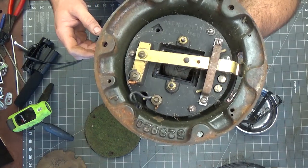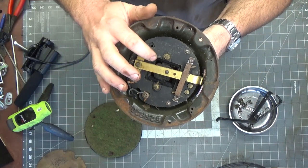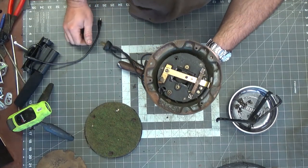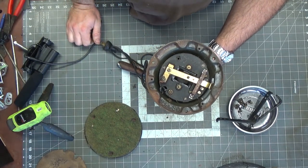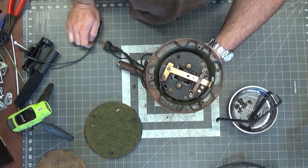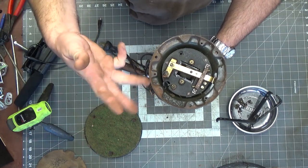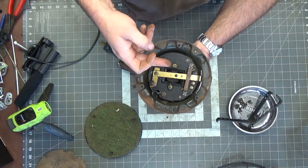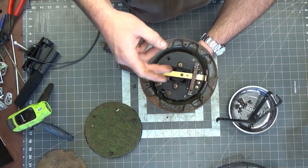What this has in here is called a choke coil. If you scroll back and look at my Hunter fan video, I had rewrapped a choke coil for a hundred-year-old Hunter fan. It was a three-speed choke coil, and what it does is offer different resistance taps — it has different pickup points on a laminated coil with wire wrappings around it.